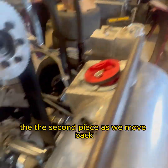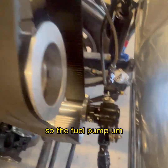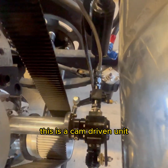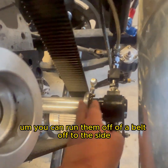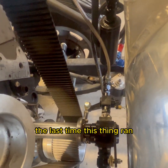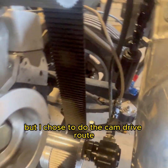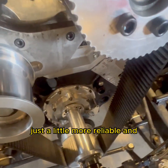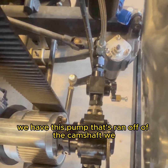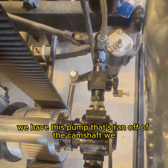The second piece, moving back, is obviously the fuel pump. This is a cam-driven unit — a Waterman. You can run them off a belt off to the side, which is how this was set up last time, but I chose the cam-drive route because it's a little more reliable and cleans up the engine bay. This pump is driven directly off the camshaft.